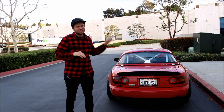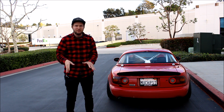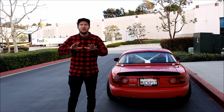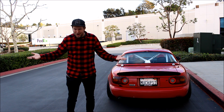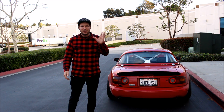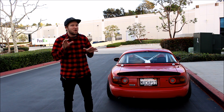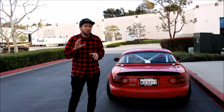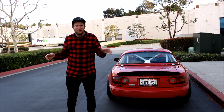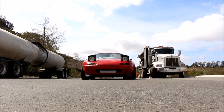Being completely honest, I know the flames look really cool, but normally I just leave it on the nice subtle rev limiter setting where it's not making a lot of noise or shooting flames. That stuff destroys your cats, destroys your muffler, and is probably not great for the turbo. Also, if you retard the timing too far — especially on a stock motor — you can bend rods just by sitting on the two-step. I've heard of three or four people that have done that to their Miata motors. I don't go much past zero degrees, maybe two or three degrees retarded at most. Play with this at your own risk. Now let's put it all together — launch control, flat shift — and do a couple of pulls.